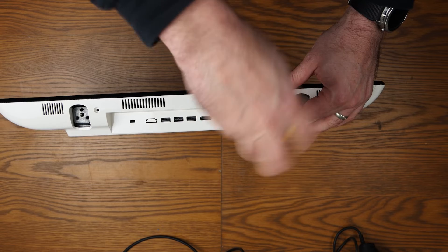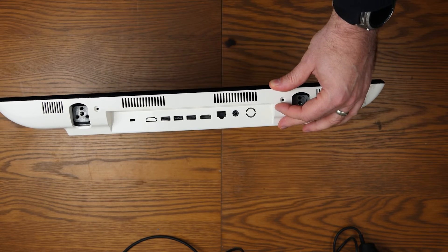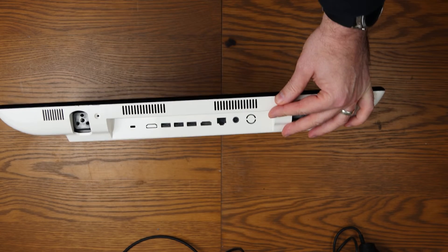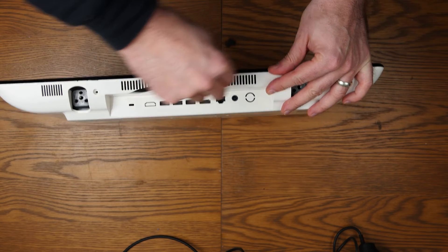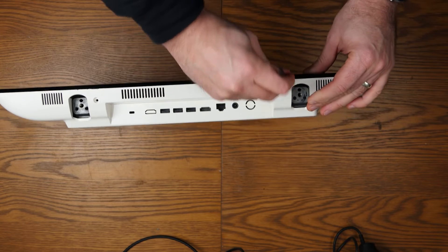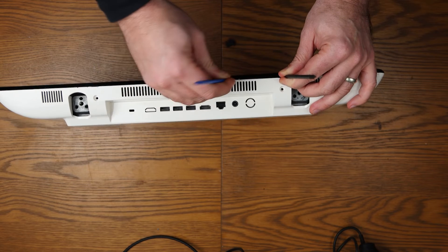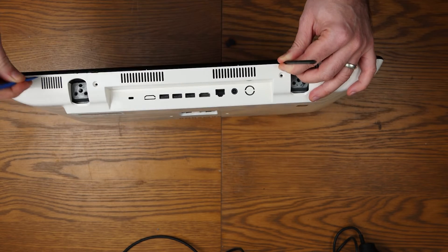So things to mention: when we start undoing the back plastic, it's clipped in and you won't just be able to pull it away. You can get a fingernail in here, but we do have to work our way around. I have a plastic spudger here — you've just got to find a place to get in. There are a couple of divots here; you can see the unit has been opened up previously. Then it's just a question of working your way around — every so often there's a little clip. So that's all now free.